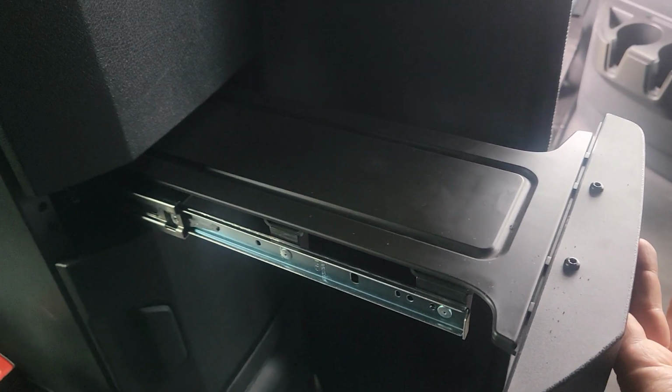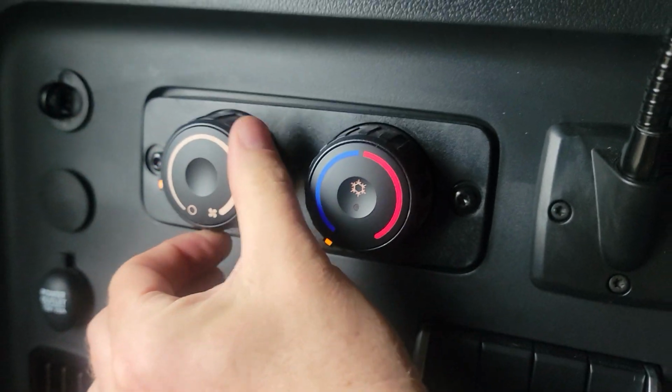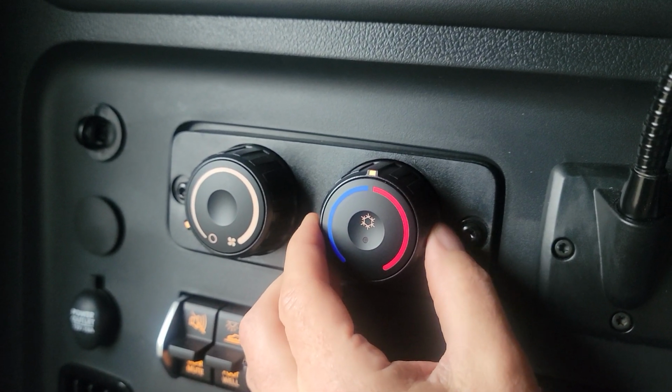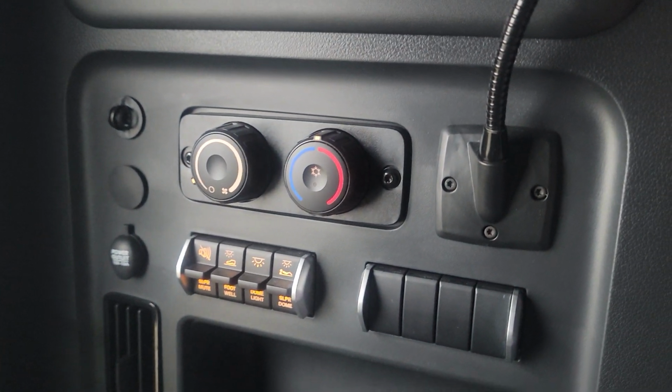Here is our coat hanger closet right here, little table, and then tiny storage down there. These curtains are insulated curtains. If you want to use optimized idle, it can preserve the temperature in the sleeper. You use this as a thermostat. So if you go here, fan on means the system's on. Temperature up here, 12 o'clock is 70 degrees. Every notch is 1 degree more, 1 degree less. And that's how you set the temperature in the sleeper. And then the truck's going to adjust to that.